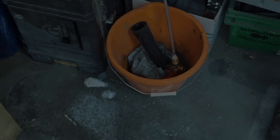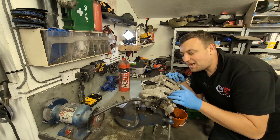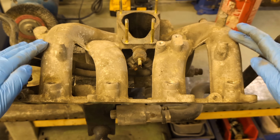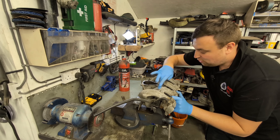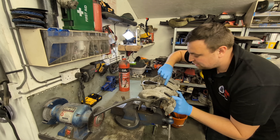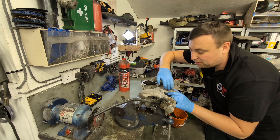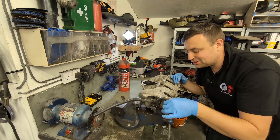As you can see this thing goes down inside, so I've got a spare inlet manifold - actually I've got two of them. The plan is to chop it off here, however I don't like the way the center runners flow - I want them all to be straight like the outer runners. So I'm thinking about cutting across here, cutting the two center runners out, cutting the external runners from the other manifold, and welding them together so they're all nice and straight.